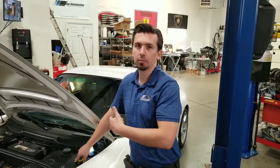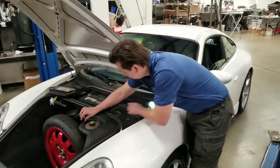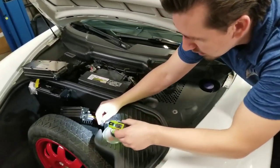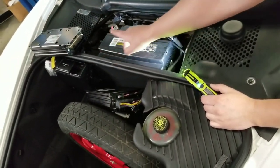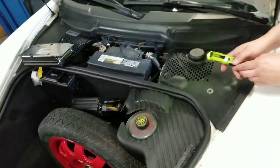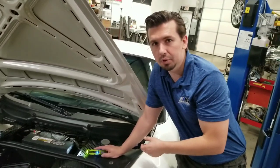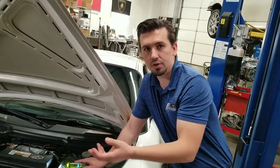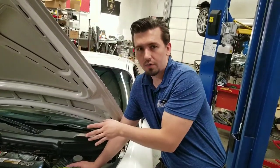We have to manually physically disconnect all the fiber optic cables, which are right here. We isolate them by shining LEDs through them to determine that the fiber optics are actually intact and not cracked. We don't want them to be cracked because if they are, they won't emit a proper signal and the systems won't work. In this case, we tested everything and all our fiber optics — receiving and outgoing — are working.